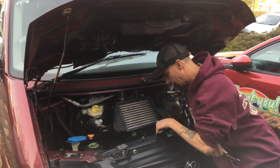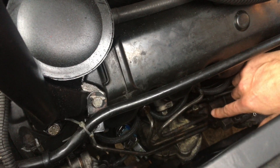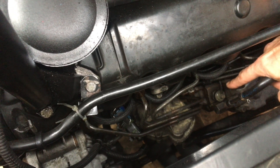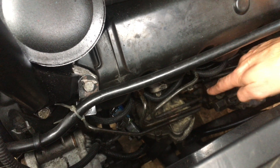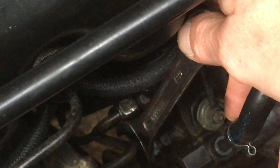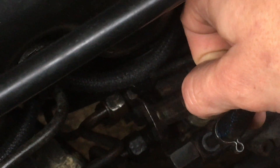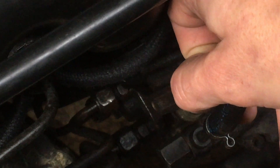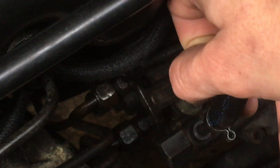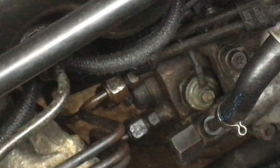What I'm going to do now — if you have a look down here where the injector goes, the second cylinder — we follow that injector fuel line down into the diesel fuel pump down here. Where they go in, we take this first fuel line off, and just in behind here there's a 14 mil. We take that out and that's like a little valve, and it might be the valve that's sticking. Let me get underneath and start taking that out.